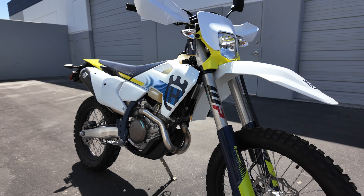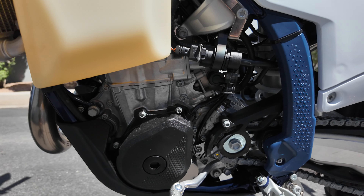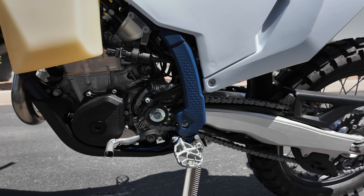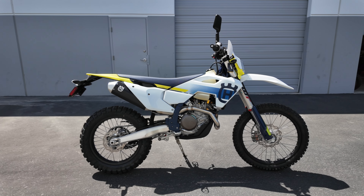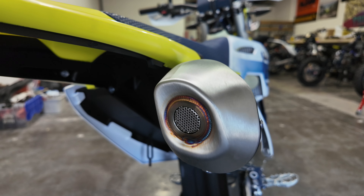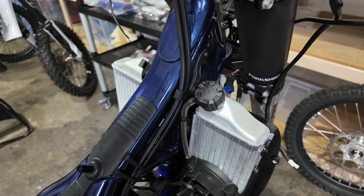For 2024, it's been designed with mass centralization in mind, tilting the engine 2 degrees backwards and repositioning the sprocket 3 millimeters lower. It's an improved center of gravity, better handling, better maneuverability, and better anti-squat behavior — and it comes in weighing less and able to produce more power. It's still going to come in at 40 horsepower stock in North America. But with aftermarket mods — a Tacomoto Athena SX-1 ECU and opening the exhaust with even an end cap from Tacomoto — you're close to high 50s, like 56 horsepower, no problem.